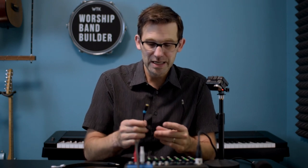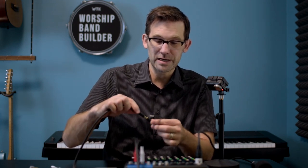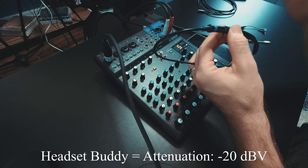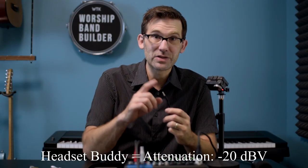I did a video on the Headset Buddy, which is really a level attenuator — a line level attenuator — because coming out of a lot of this equipment, it's too loud, too much signal to go into the input of the iPhone. This cable is probably the most brilliant cable I've found. It works very easily and it also does what the Rode does. You plug a line in here and it comes out TRRS, which is what the iPhone needs. Also, inside this little bullet, they attenuate the signal down so it's not too loud — it doesn't blow your iPhone out. It makes it the right level to plug in.